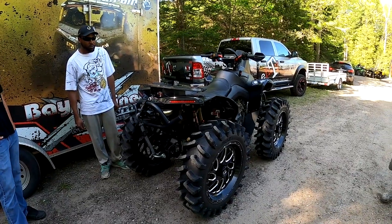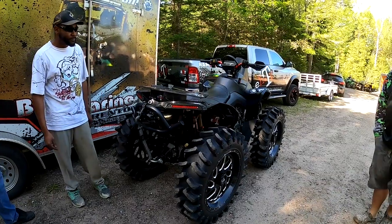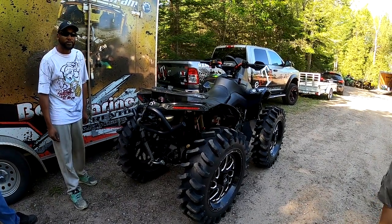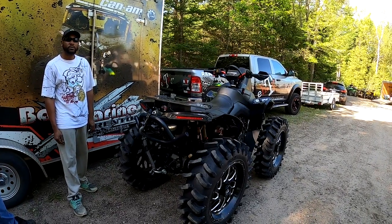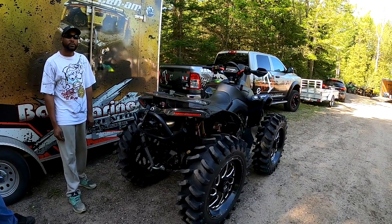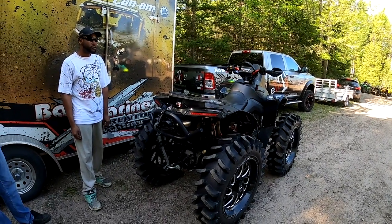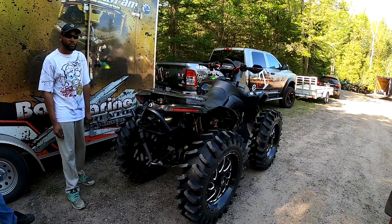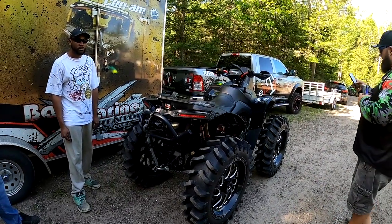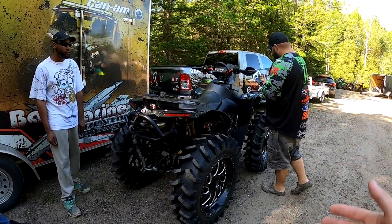That comes with your weights and your flyweight setup and all that, right? And your springs, so when you order a Helix clutch, you just tell them what kind of weight you want. Tell them every thing you know about your bike, how big the tires are. If you can weigh the wheels, that's good too. They'll take all that information, and then tell them how you ride and what you want out of it. And they'll send you a dialed-in setup. When it comes to STM, they never miss. QSC, pretty damn good right out of the box too, if you tell them what you want it set up for.